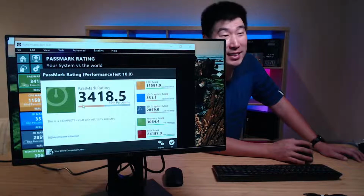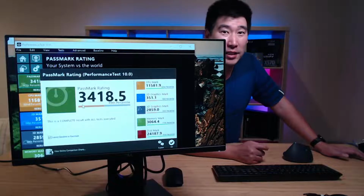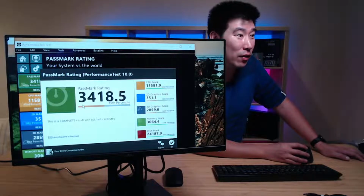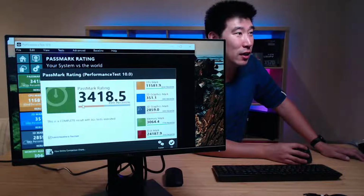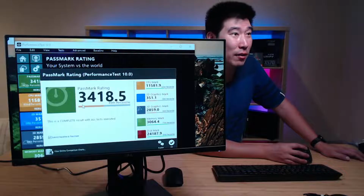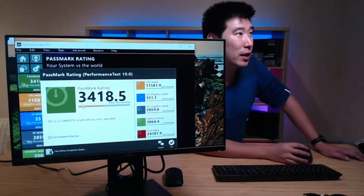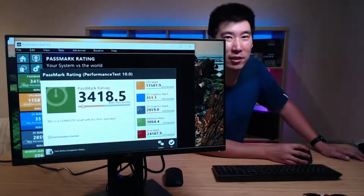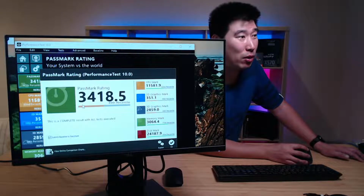Now, the i7 of the XPS 13, the model 9310, which has the 11th gen i7, had an overall score of 3,105. So that's pretty good, which means this is actually doing better than the XPS 13. The CPU score is a lot higher: 11,581 for this Ultra one, whereas the XPS 13 is only doing 9,115. That one had a fair bit of thermal throttling, and that's probably what caused the low CPU score.